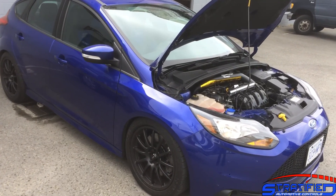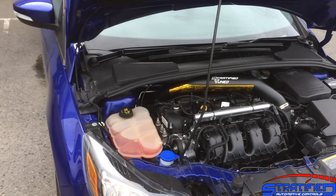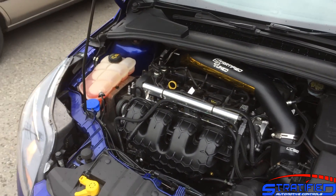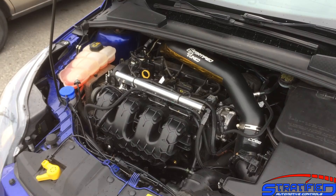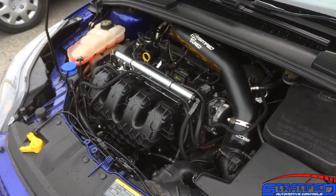Alex's Stratify here. It's been a long week of testing for a 4-port injection system for the 2.0 and 2.3. Our 4-port injection system features split-stream injection to make sure that each valve gets its own share of fuel, and also angle matching of the intake runners on the head as well as the manifold.